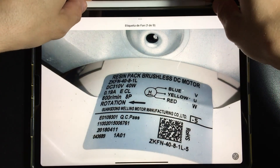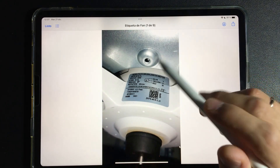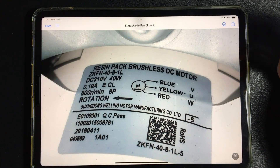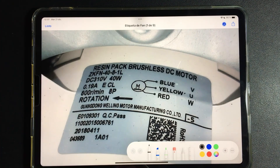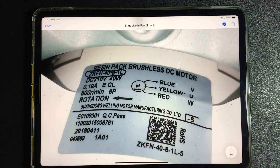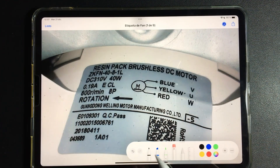There are two details you will have to keep in mind. In this case, the IPM is located on the external board — the outdoor unit. As the external board controls all the details of this fan: speed, rotation, and power consumption, it is essential that when you replace this fan it is exactly the same. That detail has to be exactly the same because the board controls everything.